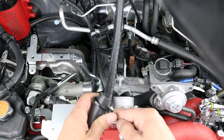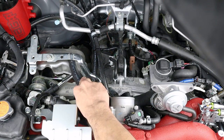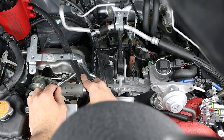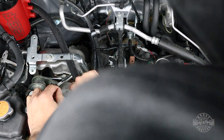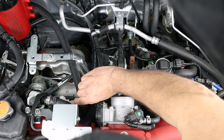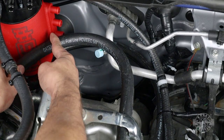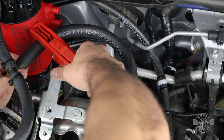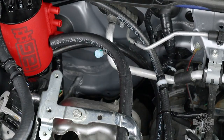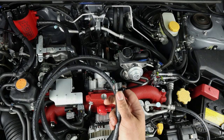Back in the engine bay, loosely attach a zip tie to the 3-inch section of hose. Lubricate the inside of the hose with oil, then slide the long end under this bracket. As you can probably guess, slide it into the other end of the Y-fitting on the drain port. Double-check the hose is completely over the barb and the zip tie is in the middle. Use needle nose pliers to fully tighten and cut off the excess. The other end connects to the bottom port — trim the excess, remeasure, then seat the hose all the way in and secure with a zip tie.